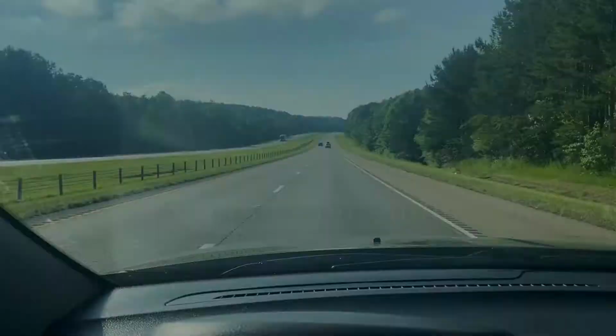If it's less than that, the tires are more squished, and when they rotate they generate more heat inside, and they'll get hotter and have uneven wear. I'll show you a picture later. My trailer tires, when I first took them off, were maybe 35 PSI, and that actually kind of ruined them. The outside tread got choppy, with bumps and chunks missing. So make sure the trailer and back tires for the Durango are pumped up all the way. That's important.